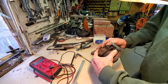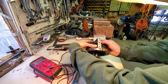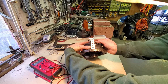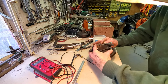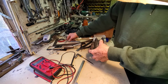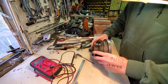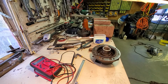And it looks like I'm pretty dead on to be about a half, about 1 degree after top dead center, looking at the white mark in relationship to the straight edge. I'm going to go with this as my baseline for moving forward with pressing. Dang you. Good thing it didn't come apart. Okay. Hang tight. We'll get the press set up.